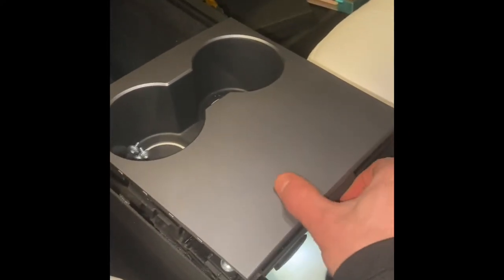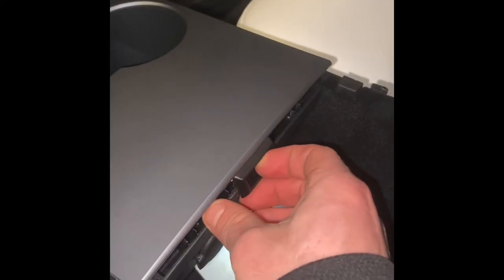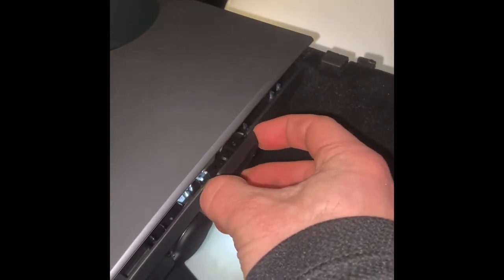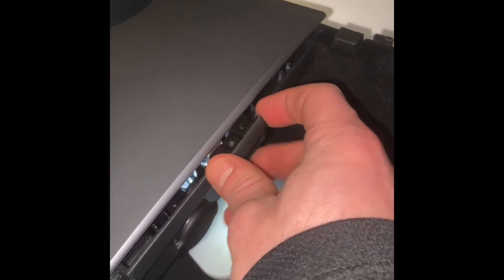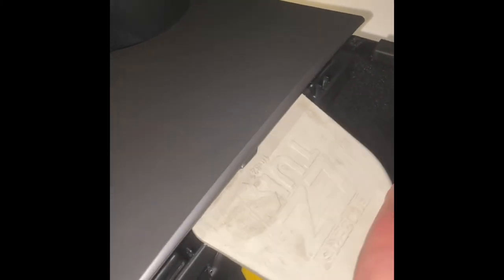To get this next piece off, there's a small piece here you have to really pull on. Then there's a Torx 10 screw poking up through the center hole — get down there and undo that. It'll fall out, and once you get that out, stick a pry tool under this and pry up, again harder than you probably think.